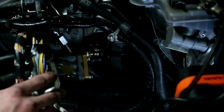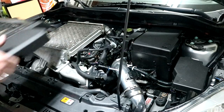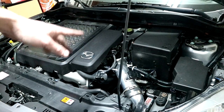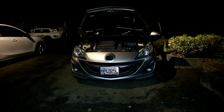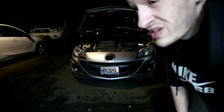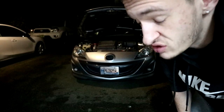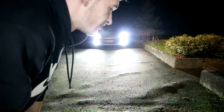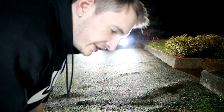Since everything's all put on and that plate is on there, I'm going to start putting everything back together. Bolting the engine bay back together, putting the top mount back on. The intakes are all on, everything's tight, I believe all the clamps are down. Rolling this out of the garage now. Startup was fine, idling is fine, smells a bit — that might have something to do with what we just did. No engine light on yet, probably not until I start driving.